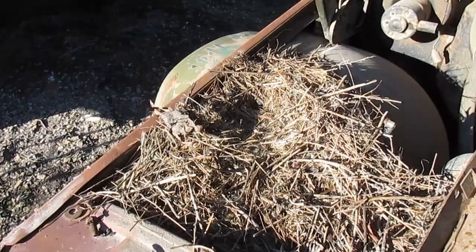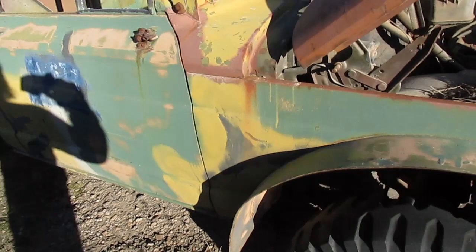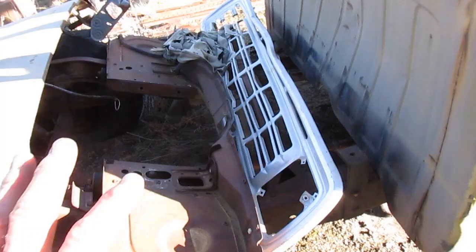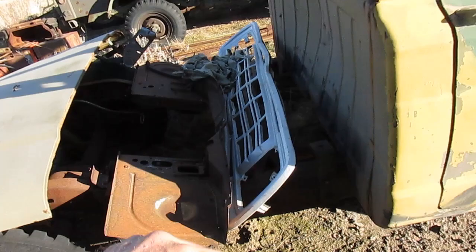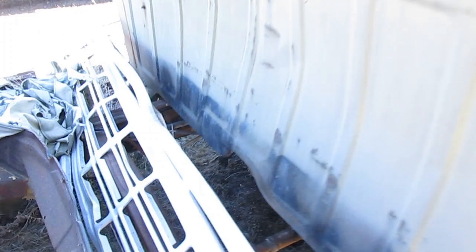This had initially come with a front winch, which is not there. I believe I had the winch assembly, and I think it's the one I put up on the other 715. Going through some dash components, because this is very interesting. This must have been the one that had a welder unit in the back, because it actually has a rear PTO, and the rear drive line to the rear axle is controlled by a yoke that slides. I can't see it without going up underneath.